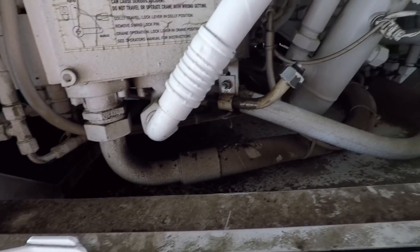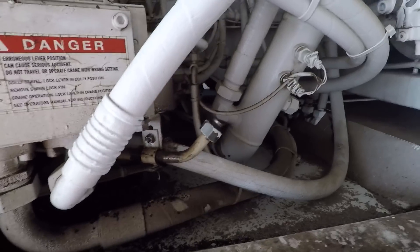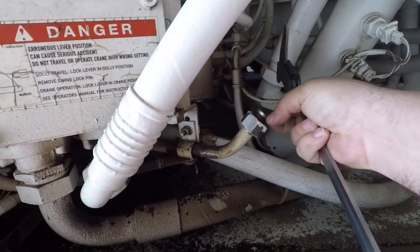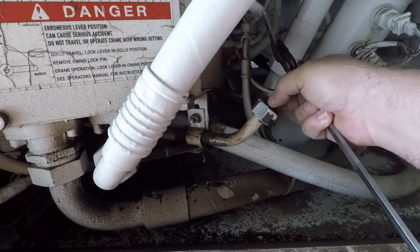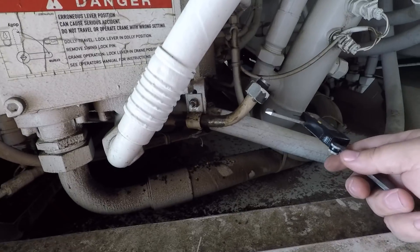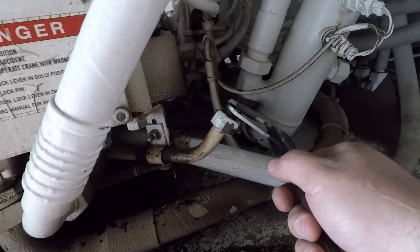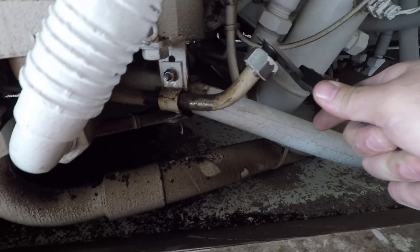So we've got to get it changed. In order to keep it from being a consistent problem, we're going to re-engineer this a little bit. But first I've got to do some measuring — find out what my actual line diameter is here. Then I'll cut this fitting off, since this isn't removable after it's tightened down, and install a new compression fitting to go from that metric steel line to a standard pipe thread or a JIC, some sort of flare. But first I've got to see exactly what we're playing with.